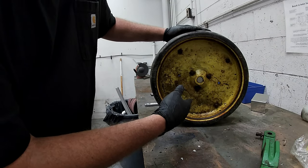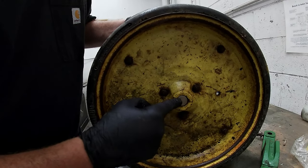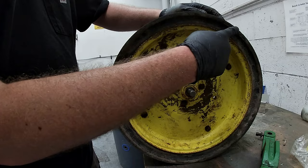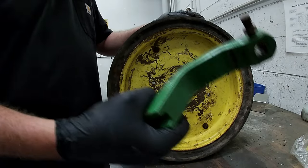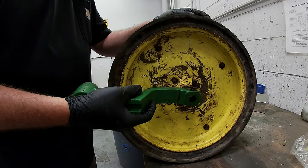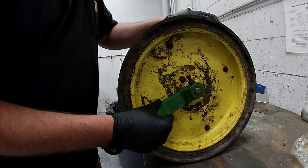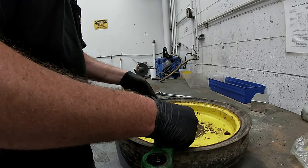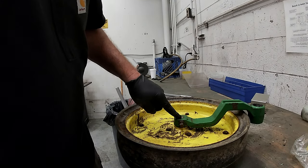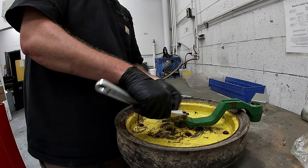Make sure the stem is on the lip side. Go around a couple times, make sure everything's tight. You can see the new bearing in there — stem out the back. The back is the lip side. Then you take your arm and it goes on the planter. This is just sticking out just a little bit — about an eighth inch — it goes on the top.